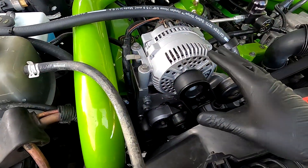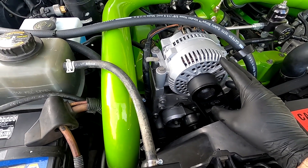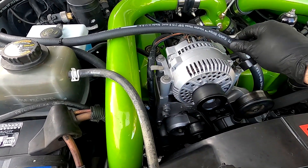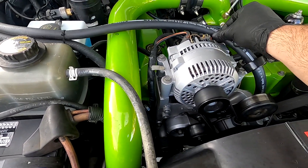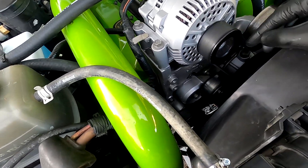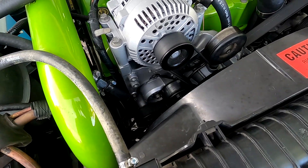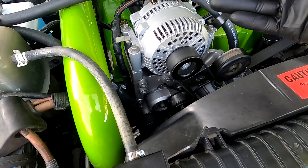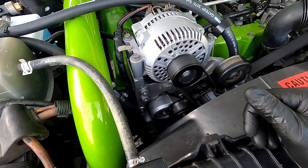It's pretty easy to do. You just got to pull the alternator out, get the alternator bracket off, do the modification to the bracket, and then these new parts should go right back on. We're not really gonna need a whole bunch of tools. We have to get the alternator unbolted - those three bolts - move this heater hose out of the way, take this wire clip off, take the belt off completely, and then it's four bolts down here to pull the whole bracket out. Once we get it out, everything's gonna be done on the bench, and then the install is a reversal.